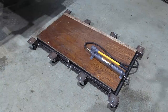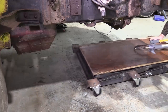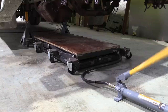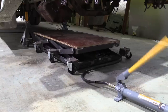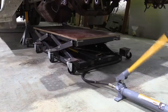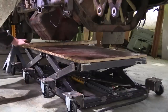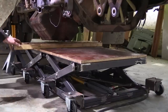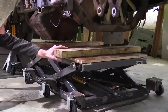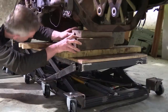To make this job a bit easier, we whipped up our hydraulic lifting platform so we can lower the engine down in a controlled manner and roll it out from underneath on wheels. Before we can lower the engine we have to get rid of two cross members — one big one under the gearbox with the two mounts on it, and one at the front below the fan. The idea is to take the weight of the engine on the platform, undo the gearbox mounts, raise the engine up to clear them, then undo the cross member and slide it back out of the way.